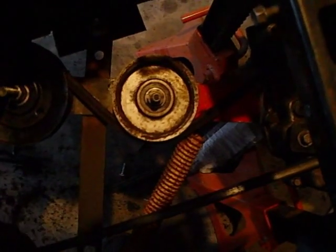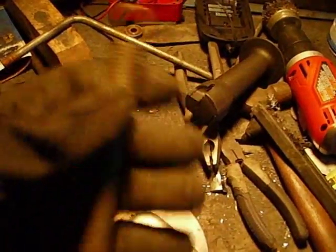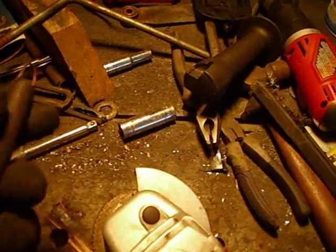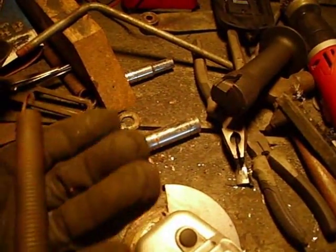With the clutch in, you can't really see it because the shadow is directly on top of the belt. That's with the clutch out — that'll be nice and tight. There's another spring I might try — this one was the next one I was going to use. We're just going to try springs that I have and hopefully find one that's semi-decent, so I don't have to give myself a hernia pushing on the clutch pedal.